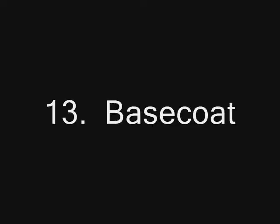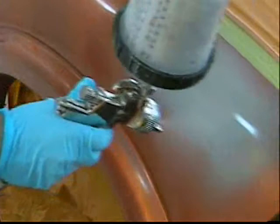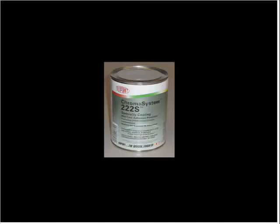We recommend the use of value shade. Apply one coat of the appropriate value shade in base coat and allow to flash 5 minutes — this will get you better color match more easily, saving time, labour, and materials. Next, apply one coat of 222S mid-coat adhesion promoter to the area beyond the primer; 222S improves adhesion over the OEM clear coat and serves as an orientation coat for the base coat color. Apply the base coat to hiding in the repair area using a detail spray gun where appropriate to keep the repair to a minimum. To improve application during blending, reduce the spray pressure at the spray gun.